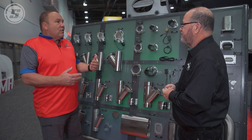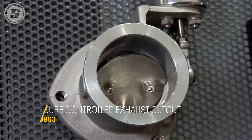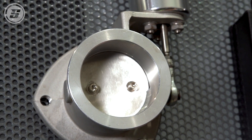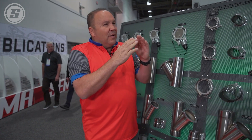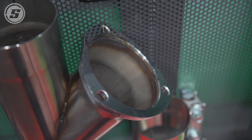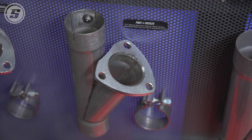With our one-touch switch, when you hit it one time it knows exactly where the valve is — so it's always fully open or fully closed. With a lot of competitive products, you have to hold the button and listen for it, which taxes the gears and over time creates play. Then you get valve chatter in the exhaust. The three-bolt header flange is very familiar — traditional, like an old-school gasser look or someone with lake pipes.